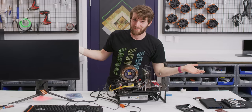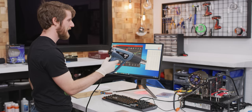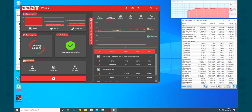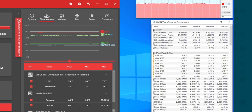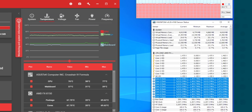Andy's prediction: it'll outperform the paste. It's thermal glue with dendritic copper and diamond. I took it to 59 degrees to see whether it kept going up or came down. It's a good thing we left headroom between the thermal pad result and the 70-degree thermal throttling limit, because the epoxy landed in between the pad performance and that limit. Unfortunately during our two-minute run, we did thermal throttle — all cores dropped down to 1.4 gigahertz and ramped back up — clearly outperformed by every other solution we tested.